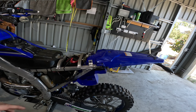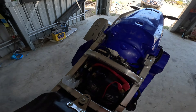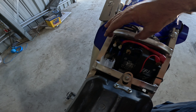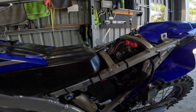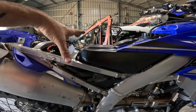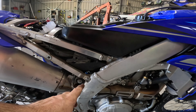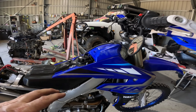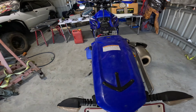I'm not sure if you have to take the rear guard off or not, so I'm just going to leave it on and see if I can do it with it on. What you're pretty much going to do now is take the earth off the battery. I'm going to cut the zip ties and move all the wire out of the way. For the subframe, you've got one bolt here, one bolt here, and the other side the same - one bolt here and one bolt here. And that should just come back. But because I've welded my bike carrier to my exhaust, I'm going to have to take my exhaust off. And I will have to take the flares off as well because the tank sits in here and I'm going to have to cut that.